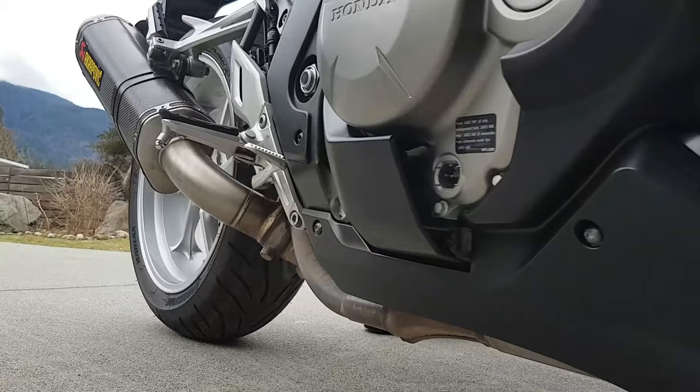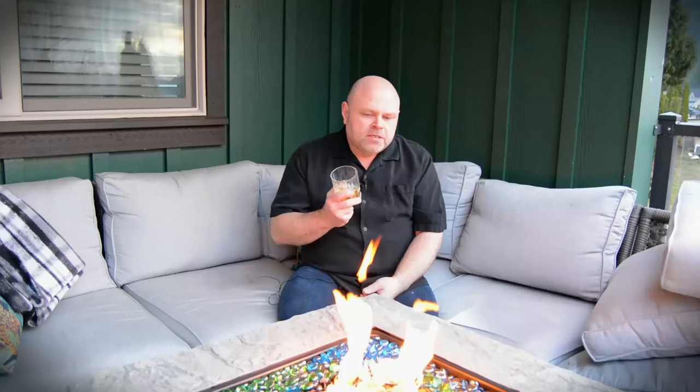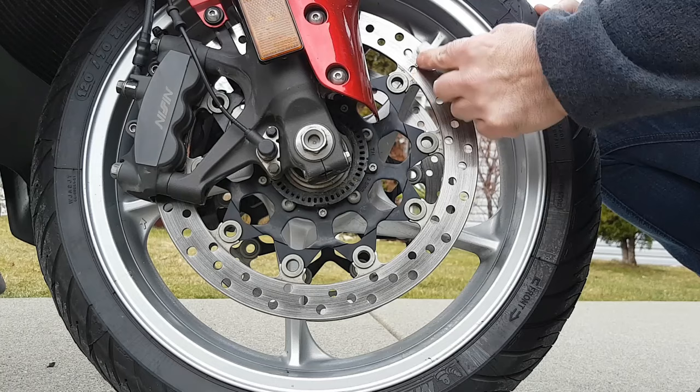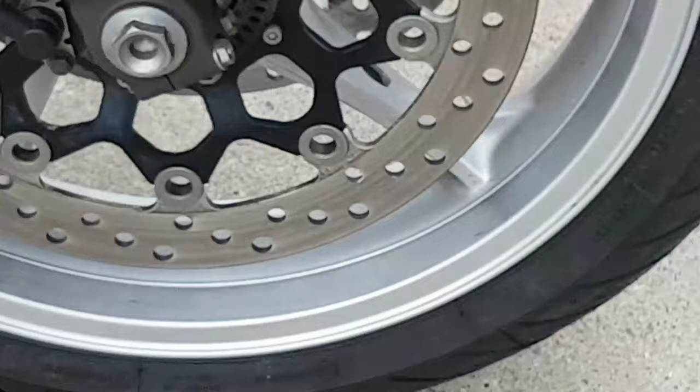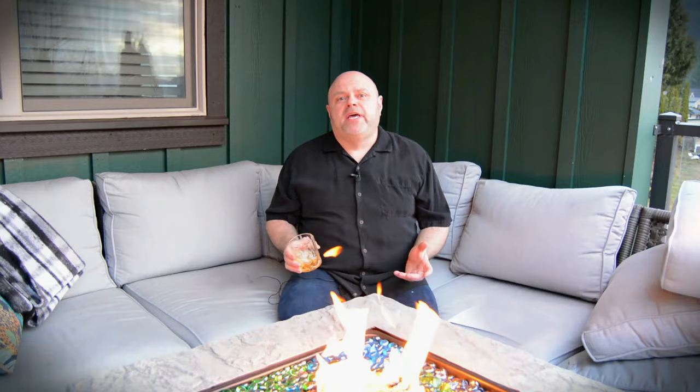When I returned home after that ride, this is what I heard. The front brakes were dragging on the rotors. My sloppy, impatient job had left me with an embarrassing sound of anything but silence. So I started the test — I marked the rotors with chalk to find out which, or maybe both of them, were vocalizing their displeasure with my brake job. Turns out it was both. A double, double dose of negligence.